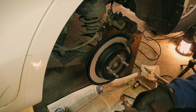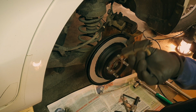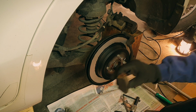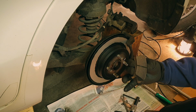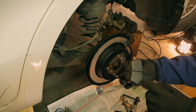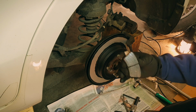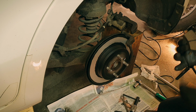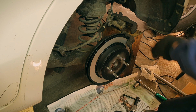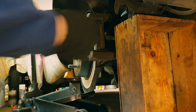Yeah, one could say that, oh, but you should put on new pads when you change the disc. Yeah, but these ones are almost new. Of course, I would have, if it had been uncoated. And this is partly why I put some extra coating here, is that of course the edges are not really touching the disc now initially, but it's just a little bit, and I think they will get in shape quite soon, so I will not bother about that. There we go, that's that pad.